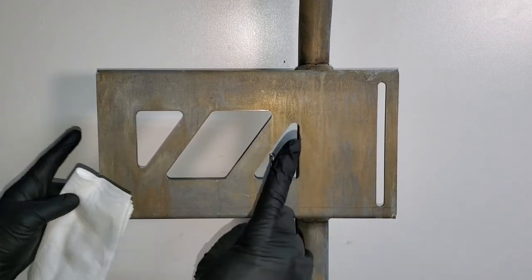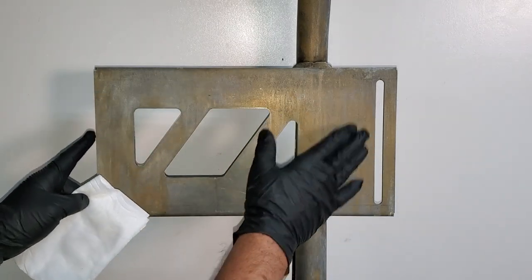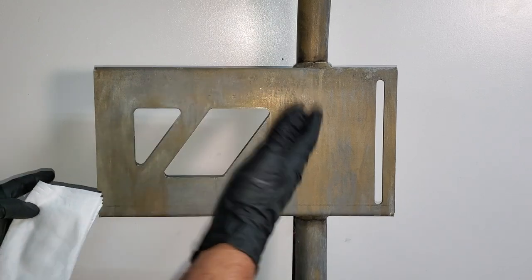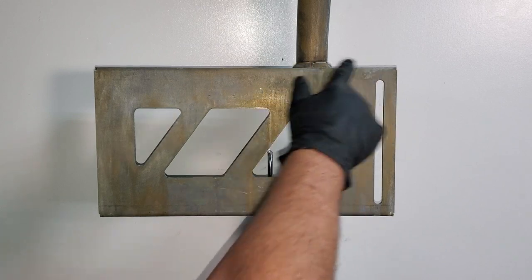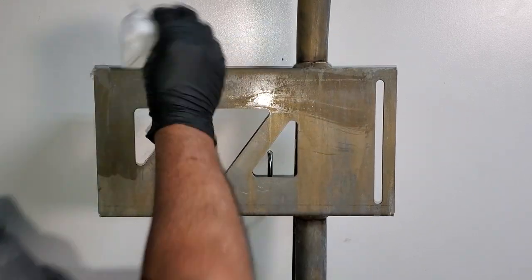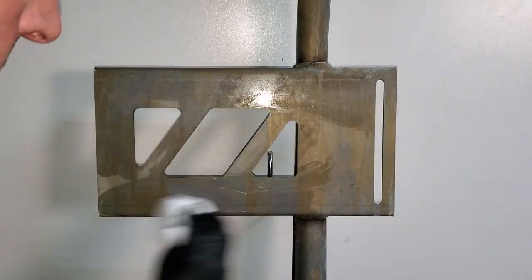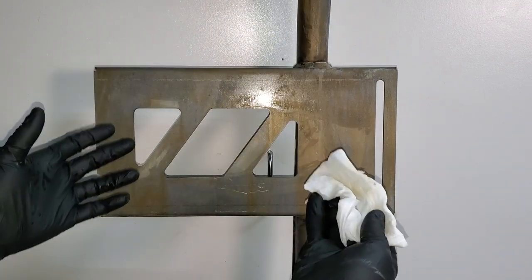Here's the next day. This was acid — it's actually phosphoric acid — and the way it dries and reacts with the steel, it creates a zinc phosphate coating, which is awesome because that's another rust preventative measure and it etches the steel. So after the process, when it's fully dry, you're going to get some residue. Get a wet rag — just water and paper towel — and wipe down the entire piece. You're going to have some fall apart, but you want the big chunks to come off. Sometimes there's a little more white residue from the acid, but wipe down the whole part.